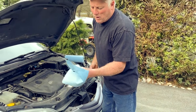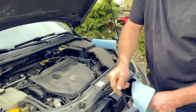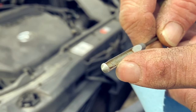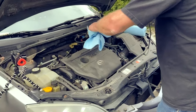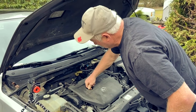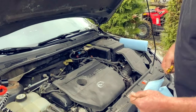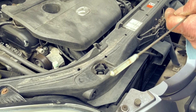We're going to see where the oil is on the stick. The area we're looking for is between these two lines — this is full, this is add. Anywhere in between is fine. I haven't pre-checked this, so it's as fresh to me as it is to you. And it happens to be no oil on the stick, so we need to add oil to this car.